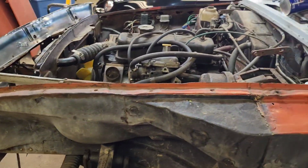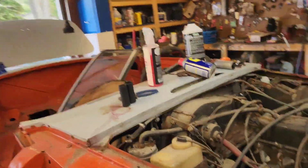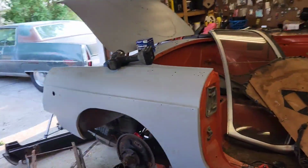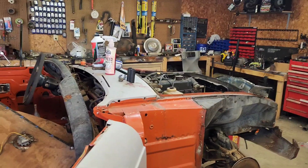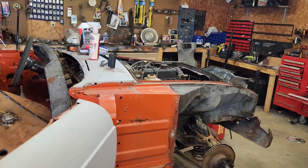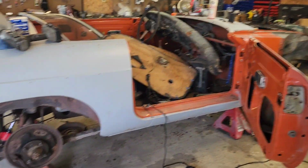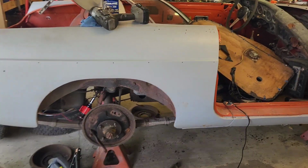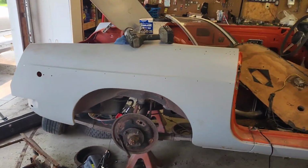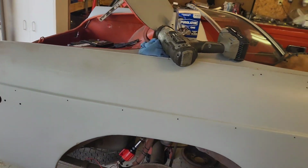But this pump doesn't seem to be having that problem, because I can have this thing, it seems like, set to like 4,500 RPM, which is realistically about all the more I want to crank it. And the fuel level doesn't drop in the filter, or at least not by a significant enough amount to make me concerned that I'm going to run out of fuel while driving it. And it does slowly start to build back up. So that pump does appear to be keeping up, at least when the car is not under a significant load. Now, put the car under a significant load, that may change, I don't know. We're going to have to kind of play it by ear and see. I also tightened up the fitting at the back, so that seemed to be another part of the issue.